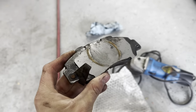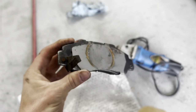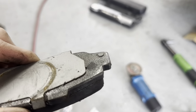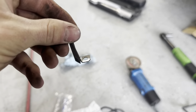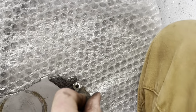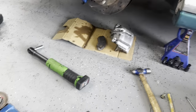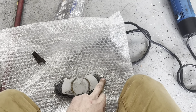If you use Integra Type-R calipers, there's a little squealer bracket right here — go ahead and grind that off. There's just a little notch right here. Grind that off and take the bracket off because you do not need that with these calipers. I just took my cutoff wheel and lightly sanded it down to break it off. This is the finished result — the caliper and brake pad are good. Of course, only one of the two pads will have that squealer on it — the backside pad.